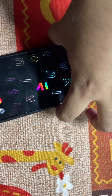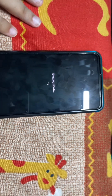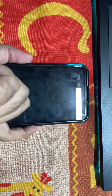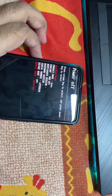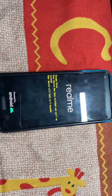Let's see if we need to flash Magisk or not. Let's power off, go to fastboot, and go to recovery from there. It will take some time. The phone has gotten a little hot, which is fine because we installed a new OS. In fastboot mode — volume down and power button — we'll go to Recovery Mode. Let's see if we have the recovery or not; if not, it will be a problem.